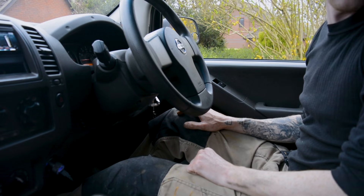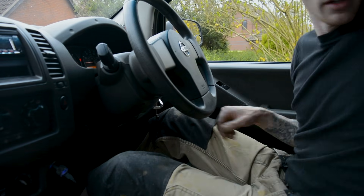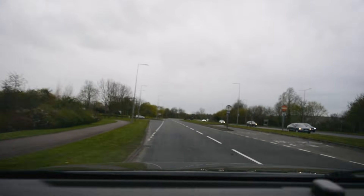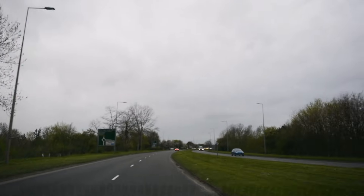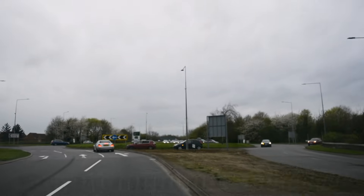There's a little bit of rough starting up there, but nothing's going up and down on the needle, so I'm going to take it for a little spin. Everything's driving nicely — it seems to be a bit nippier on the acceleration now and doesn't seem to have as much turbo lag. Just took the Navara out for a test drive — really happy with how it responded to the new suction control valve. Hopefully that helps some of you guys.